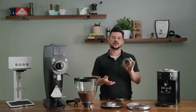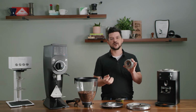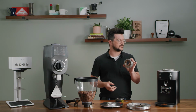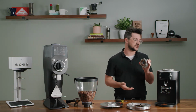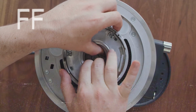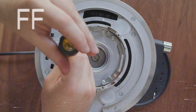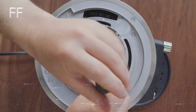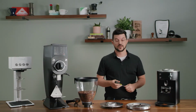As we know, this cut pattern accentuates the sweetness of your coffee and gives your coffee a really good taste. So that's why we continued that cut pattern in this next generation grinder, the E80 Supreme. I will put the top grind chamber back on, screw down these 3 screws, and let's talk about burr calibration.